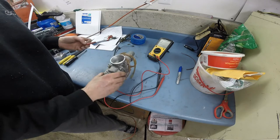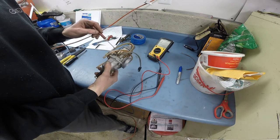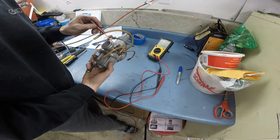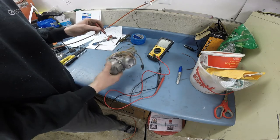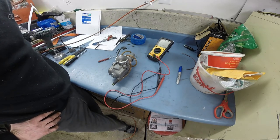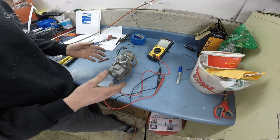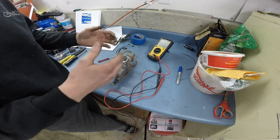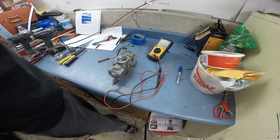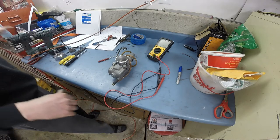Just for your reference, this is a carb off the machine I parted out and the safety switches are still on the side of this carb — that's with a two-wire plug, then a small plastic piece screwed to the side of the carburetor. I wanted to do some more thinking through on this. I want to know how that magnet switch is supposed to work. I'll show you guys the book — it shows the switch in an open condition. I'm just trying to figure out what the proper condition is.